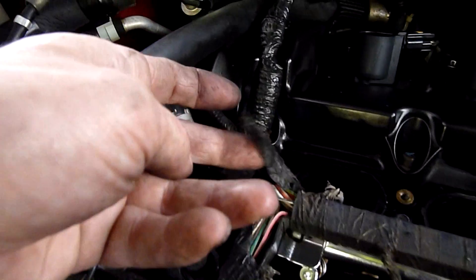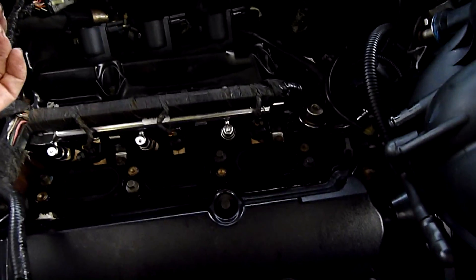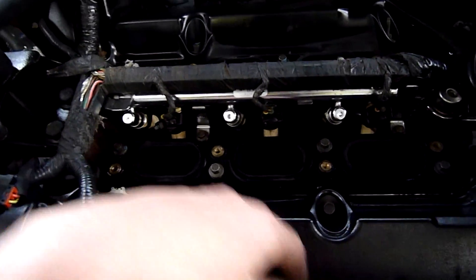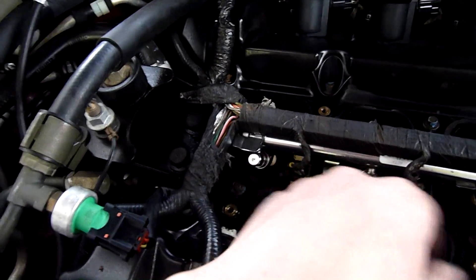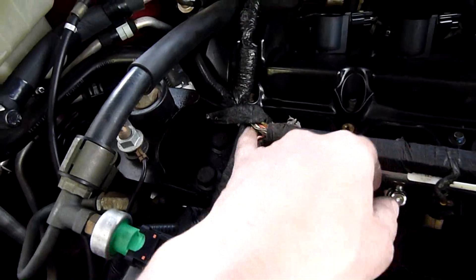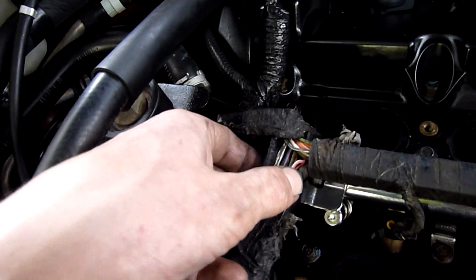It's kind of interesting that the fuel rail connectors are all cable-tied down, even down under here - all of them are cable-tied on. And what the hell do they wrap this loom with? That's not loom tape, that's like gaffer tape - that's kind of nasty. I bet it's an American engine. It's a Japanese car, a Mazda-built Escape, but the engine's a Duratec 30 so it's probably an American-made engine. I've seen notes on forums about chafed wiring causing misfires, so that's something I'm going to go through.